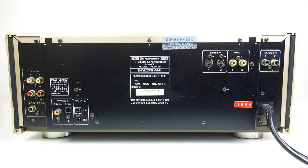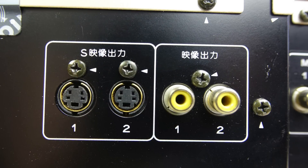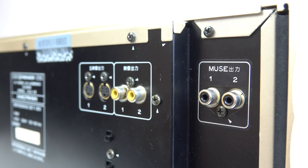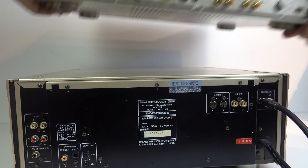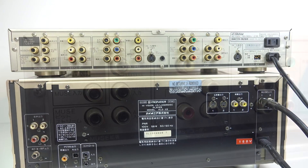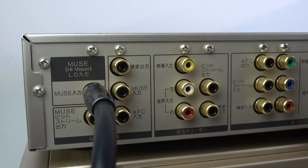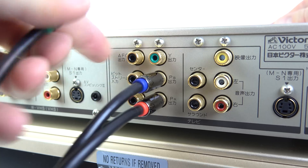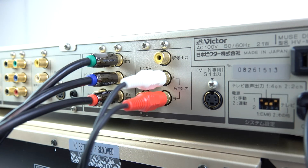If we take a look around the back of the machine you'll see that quite a few of the outputs are duplicated to make it more convenient to connect up with AV systems. However, when it comes to playing HiVision discs you only need to use one wire to connect the player to the decoder. This cable carries the video and audio in the form of a Muse signal, and then it's the decoder's job to convert that signal into video and audio that the TV can use. The HD video is sent out over component leads and the audio via standard RCA cables.